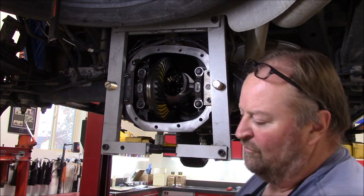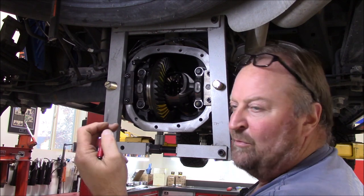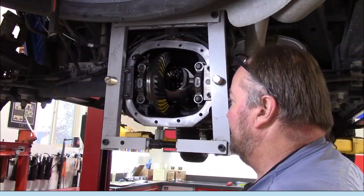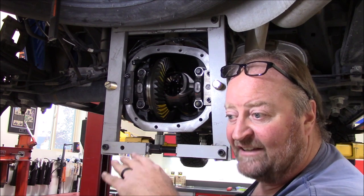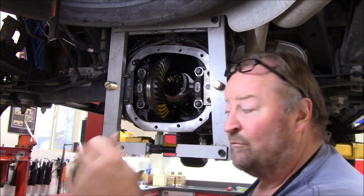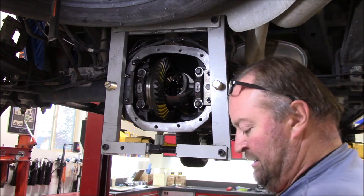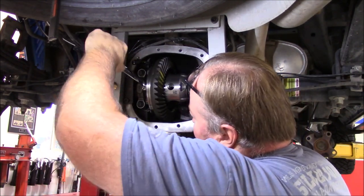The convex side is going to be your drive side. Basically imagine the drive shaft going around — it's trying to push that gear straight. On the coast side is the concave side. Generally that's why they go low pinion on the rear, so you're driving on the strongest part of that tooth — the drive side, the convex side. On the front, that's why a high pinion front axle is so sought after — you're actually driving on that same drive side of the ring gear. The pinion is actually trying to straighten that out. That's the strongest part of the tooth, so you want to make sure you check both the drive and the coast side when checking a wear pattern.